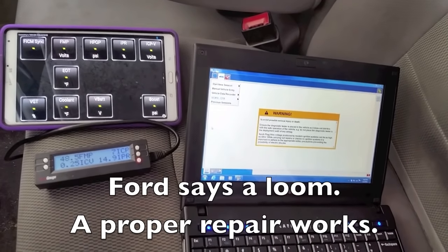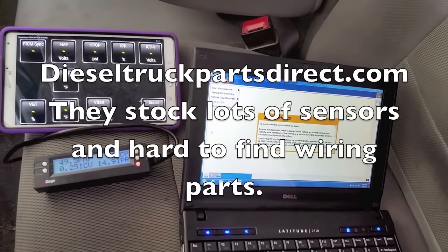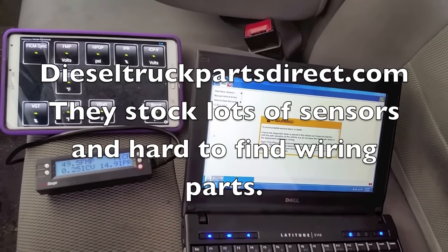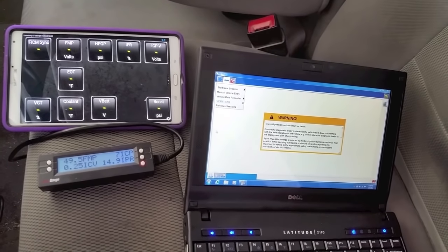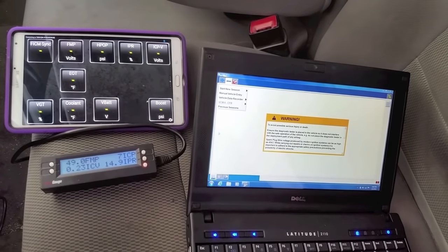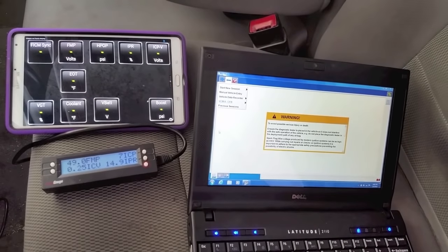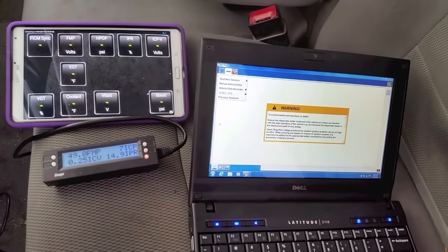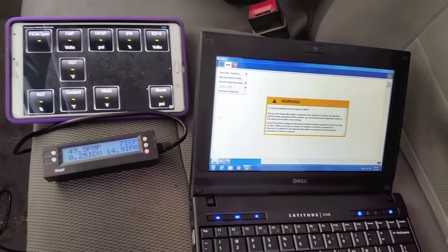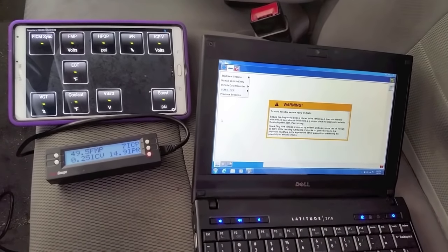So we're doing a wiring repair. This wire came from Diesel Truck Parts Direct — he makes long leads on them, two feet of wire, so you're not splicing in just six inches at the end of the loom and having to splice again. The fewer splices, the better. He'll sell them to you already twisted. You can also remove the shielding from your original wiring and reuse it.